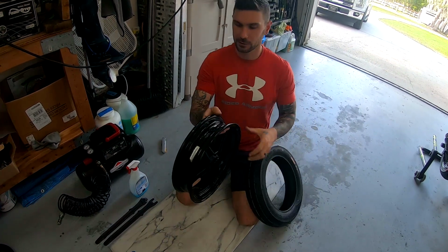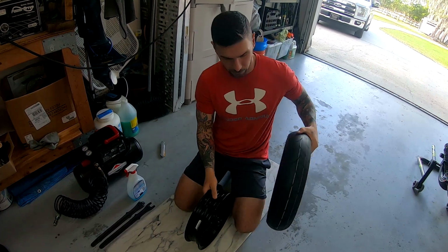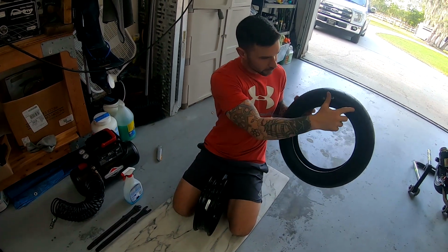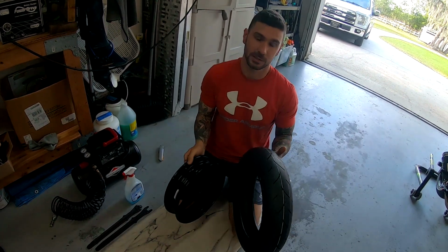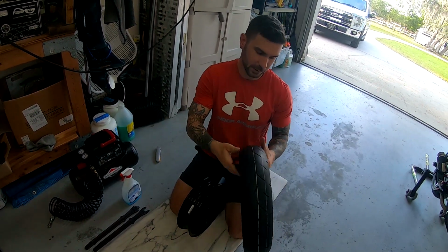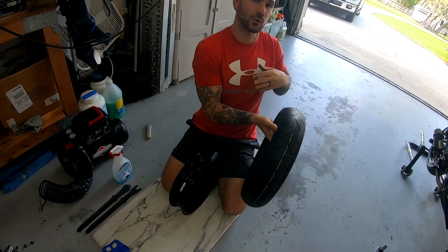The other thing is get the orientation. The wheel is going this way. And you want to make sure the rotation sign on the tire is going with the wheel, especially if it's a DOT tire. You have water siping in here, and you don't want it backwards. You don't want it to push water into the tire. You want it to push water out of the tire.